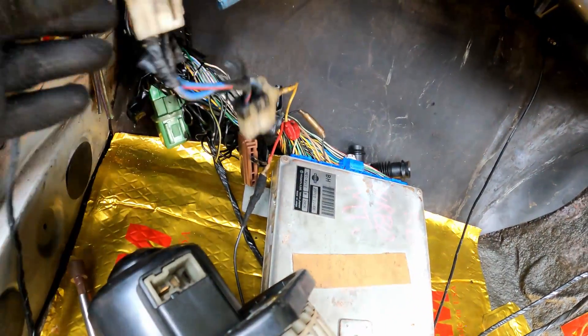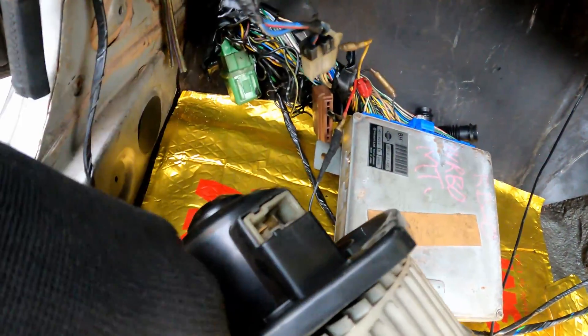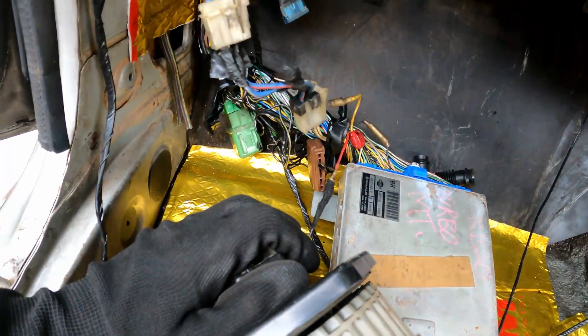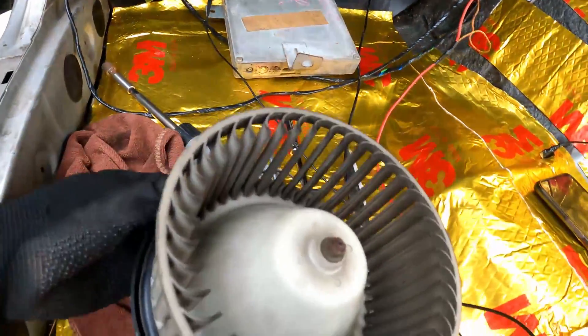The wire is long enough — so why didn't they just crimp it with another connector? I'll need to find this connector with a pin. It uses a normal terminal like the ones you use for audio systems and stuff like that. So I'll probably just remove this top black cover, pull out the wires and the terminal pin, cut it, make a new one, and reuse this connector to plug in directly — that way you don't have wiring coming out getting shorted.